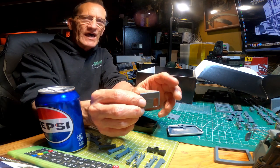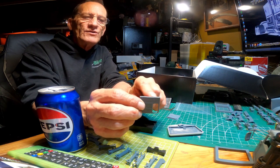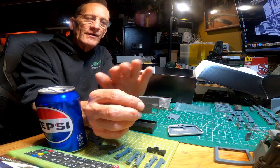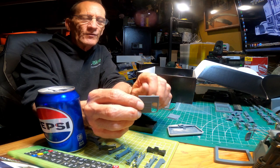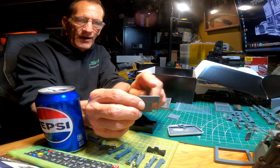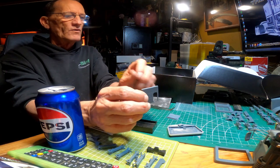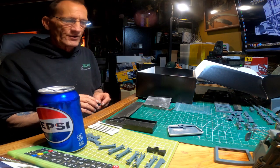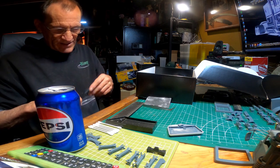And you can also use this door panel as a guide to the proper angle in which you're going to cut the windows out as well, because you're going to take out the wind wing bar and you're going to profile the window down with a slight angle to it in order to create a proper 389 from that 378 cab.